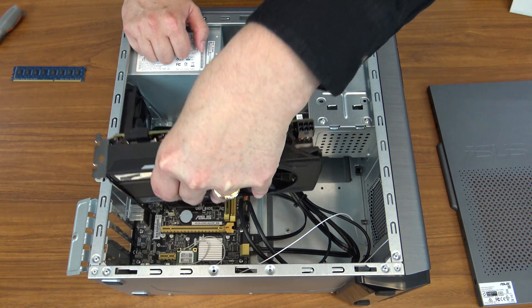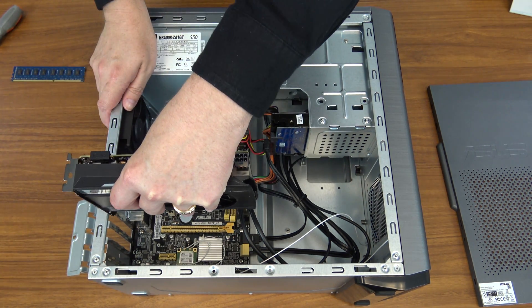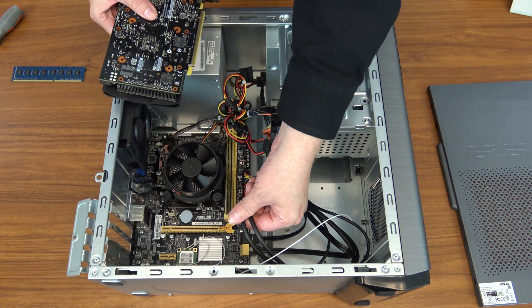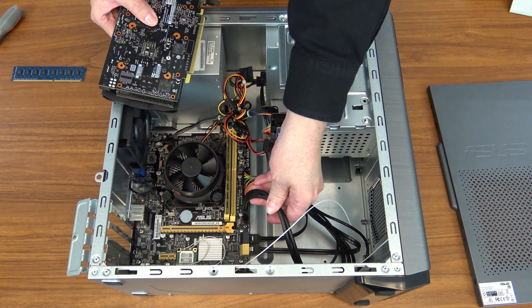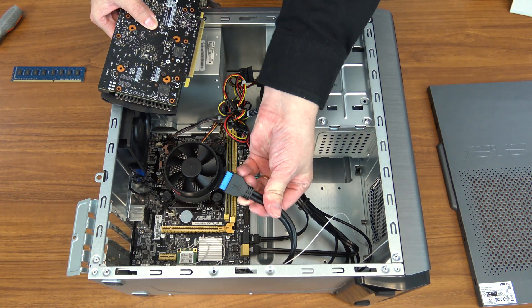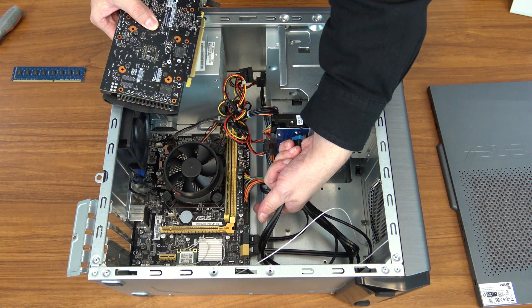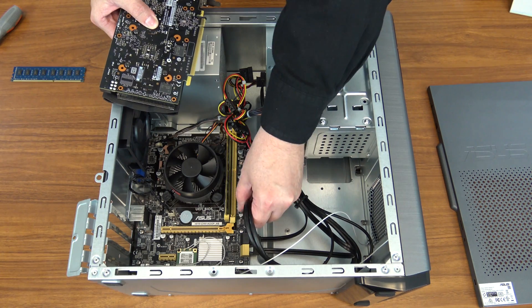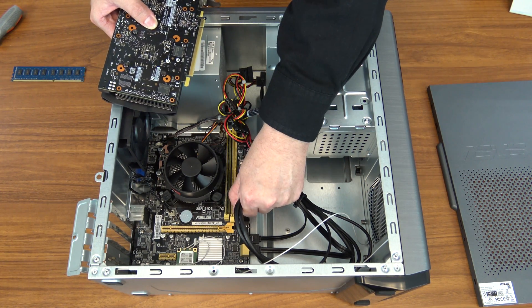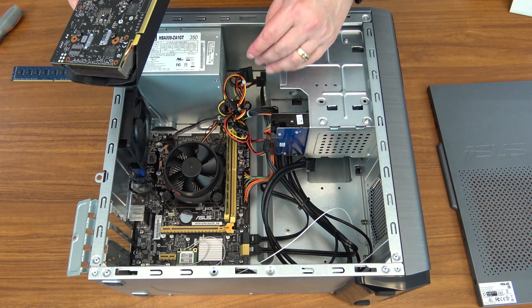Graphics cards go straight in and straight out — you don't put them at an angle. You do have to offset towards the front of the computer because if you try to go straight down lined up with the slot, you're going to run into the edge of your computer. Also be aware of the USB 3 ports on the front of your machine. You can bend these over a bit, but watch out — this plug, the blue part, is in the motherboard. If you just bend this over, you may snap that port on the motherboard. So you may want to pull that out and just move this to the side, but just remember to plug it back in. I'll pull that out for the time being because if you break that, you don't have any more USB 3 ports.